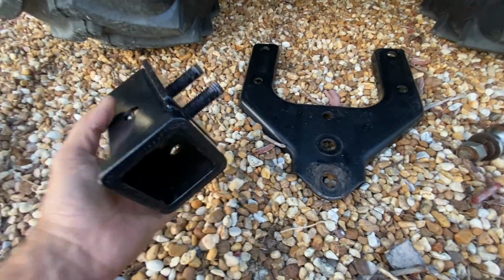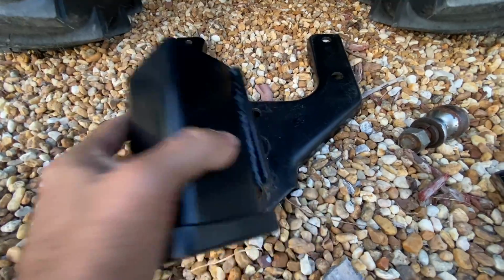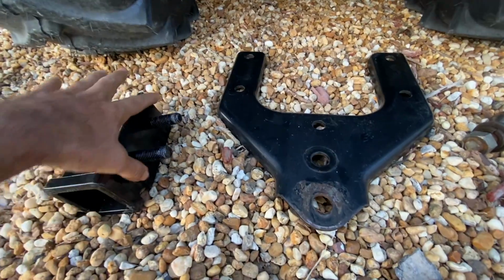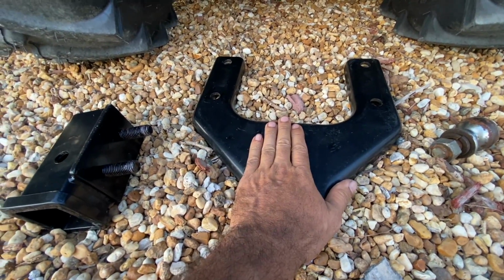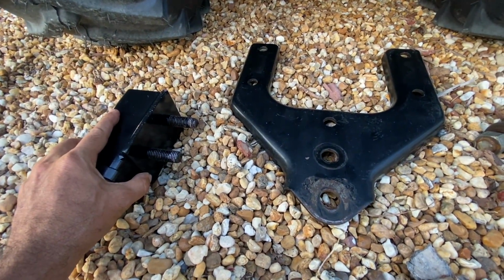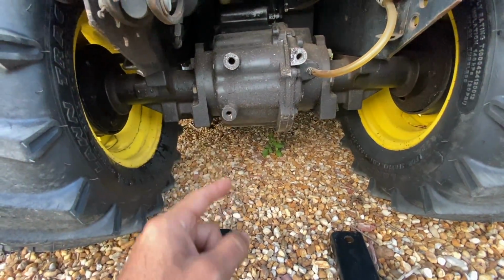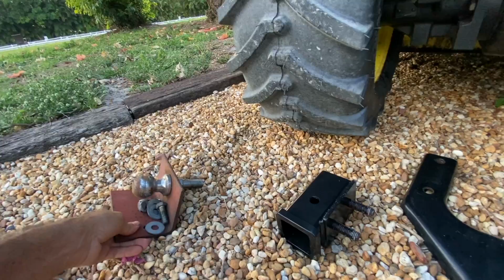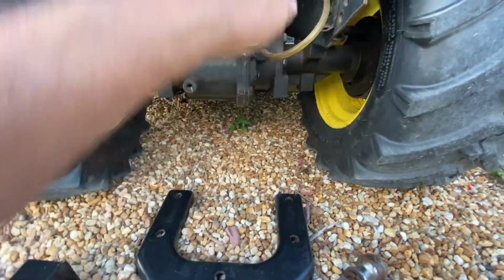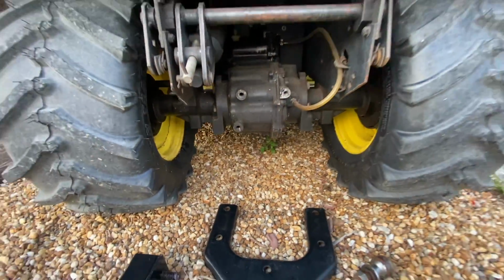So we've got this square receiver here that actually bolts right into this as well. Two different positions are possible, and it's really cool because it will displace the load across more area and essentially increase the strength of the entire unit as a whole. So we're going to put that on. We'll see how that does, and then we should be able to pull some heavy stuff, or at least heavier than this, because that's just asking for trouble. And it'll get the hitch ball away from the rock shaft as well. So we won't have to worry about clearance there anymore. So let's get that on.